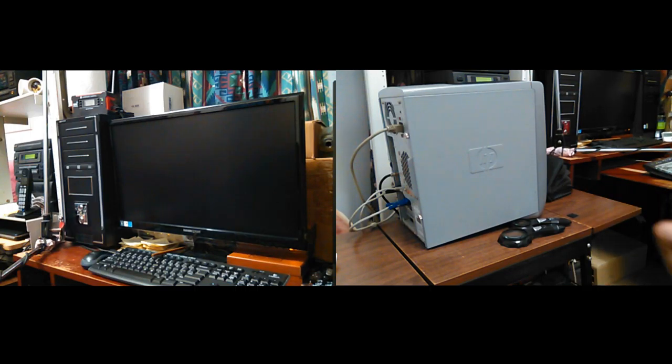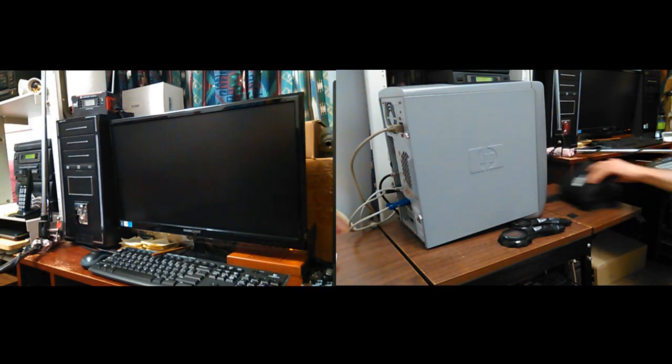I got a floppy boot disk that I'm going to put in there and see if I can make it boot. Well, I could put a CD in it. Yeah, let's do that first because sometimes that's more tricky to get to work. Let me see what I got here. I want something that's diagnostic. Yeah, Parted Magic, that's what I want. That way I can check the hard drive and everything. Diskless remote bootable. That's the one where you can boot this up on another machine and then boot others to the network, but you've got to have a switch that doesn't have a DHCP server.